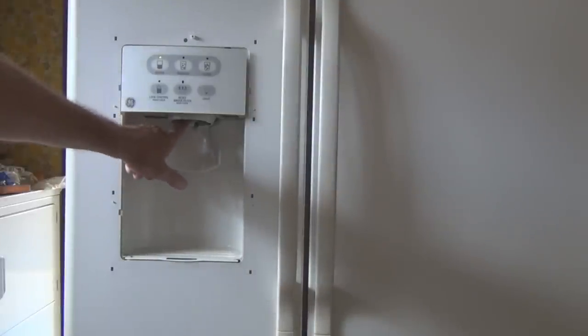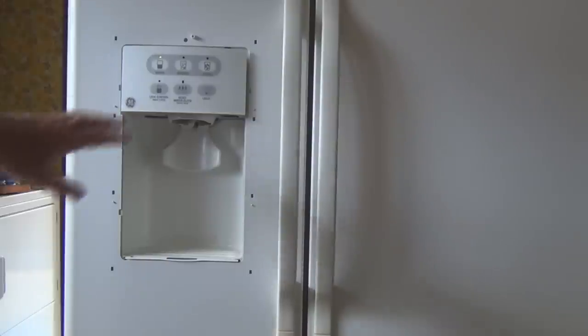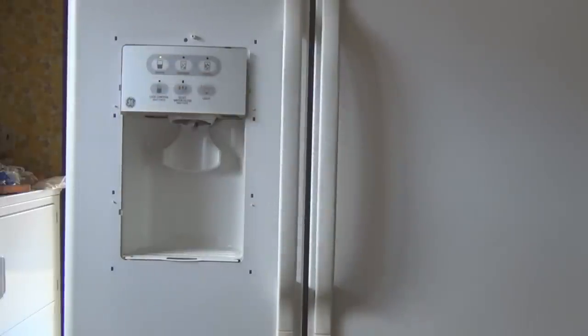There's a heating element that you can install around this nozzle here, where the water just feeds out through the door on this freezer section, and it freezes. So they have come up with a solution. It's a little heating element that you press. It's got some foil double-sided sticky tape that presses around that tube area and splices into existing power connections on the cables that feed this front panel. So I don't think they had that when I first inquired about this problem years ago.